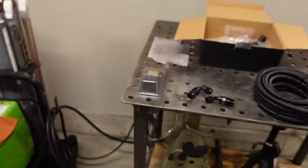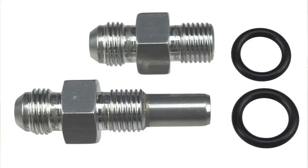If you're doing this on a 4L80, pay attention. The rear fitting of the cooler on a 4L80 — I think the later models from around 96, 97 and newer — you will burn them up if you run this exact part number of fitting in the case. The reason is there's a special extended fitting that goes on the rear only to provide lubrication to the rear drum, and if you don't have that special fitting, it will burn up due to lack of lubrication. This is a 4L60 so that doesn't apply, but keep it in mind if you're swapping in a 4L80.